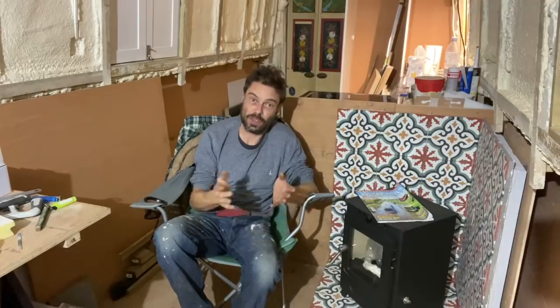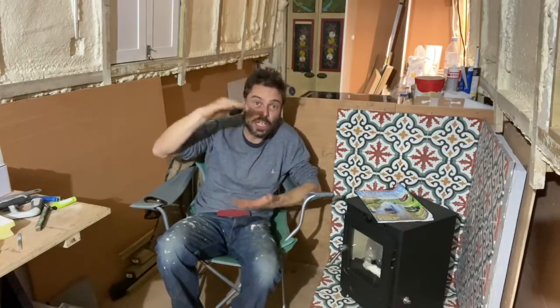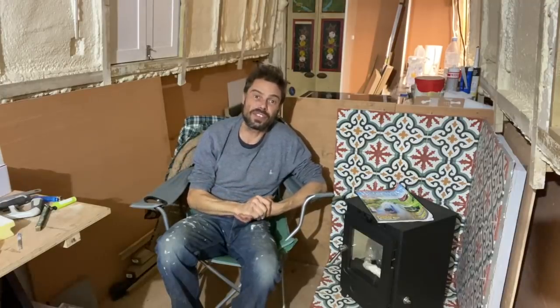The reason it's caravan and not marine is twofold. Well, no, it's onefold. It's price. Caravan stuff is cheaper than marine stuff. Go figure. But caravans also, like marine stuff, need a lower ceiling height. So this is a 1750 shower enclosure. The stuff you'd have at home tends to be 1850, and then you put on a 50 shower tray, bring it up to 1900.